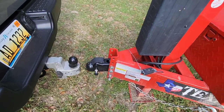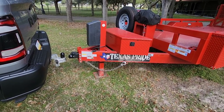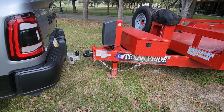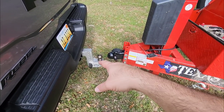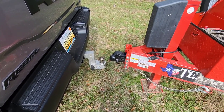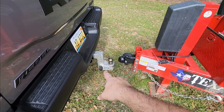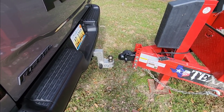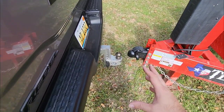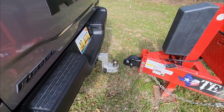This truck sits really high and the trailer is really tilted, so I'm going to have to drop down the WaySafe hitch a little bit. We have it lowered down to the very bottom notch. This shank is rated at about 14,500 pounds, and the hitch head — the portion right here — is rated at about 21,000 pounds, so there's a big difference between the two. This one's designed for a 3-inch shank, but this is a 2.5-inch shank.